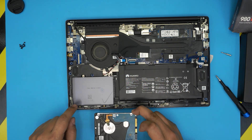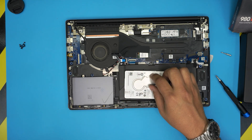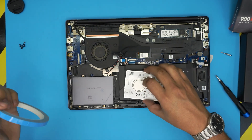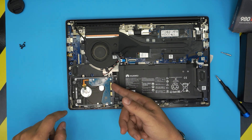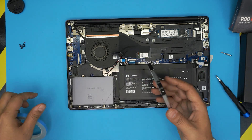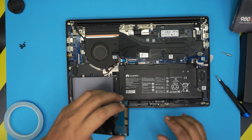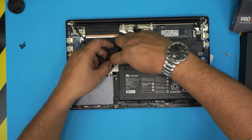There's a caddy — a metal bracket with four screws — to hold the drive in place, but it's not included. Honestly, you don't need it. All you need is double-sided adhesive tape — I'll leave the link in the description. Put one or two strips in there and stick the drive right in place. When you want to remove it, just peel it off. Don't use any other glue. The same thing applies if you're adding an SSD — same process. That's it — now you know how to add an extra hard drive.